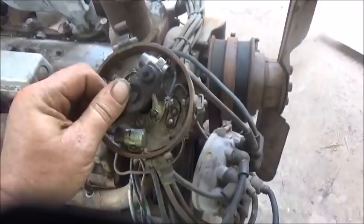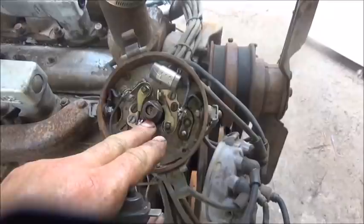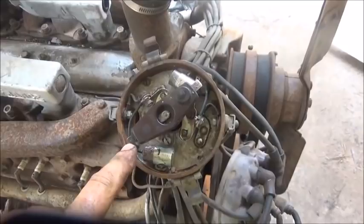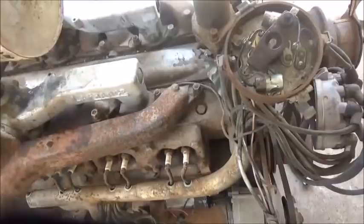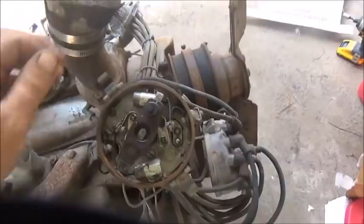So what we've got is I cleaned the points — they're good to go, ready. You've got to run two coils — you don't have a choice because there's only six lobes on the distributor. One set of points is running six cylinders. The other set of points is running the other six cylinders using two coils, feeding one through here and out here, and one in here and out here. That tells it when to fire on each particular cylinder in the cap. So it's two separate ignition systems on one cap. Basically there's four six-cylinder ignition systems here.